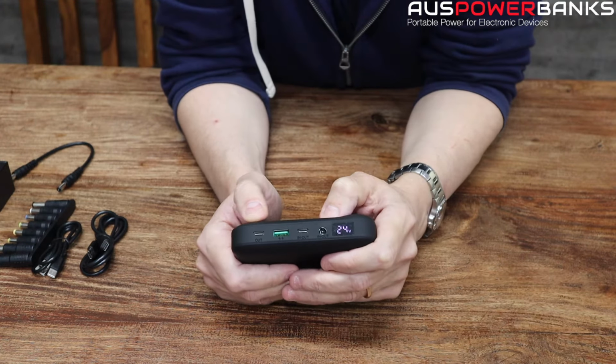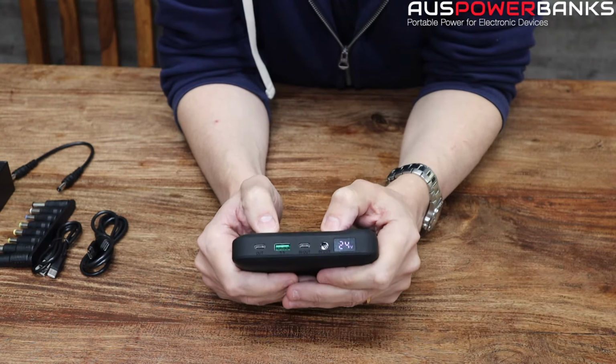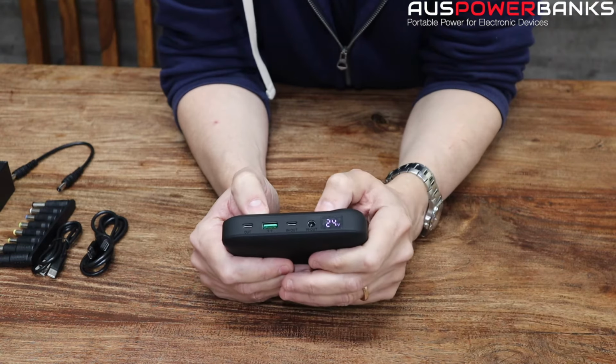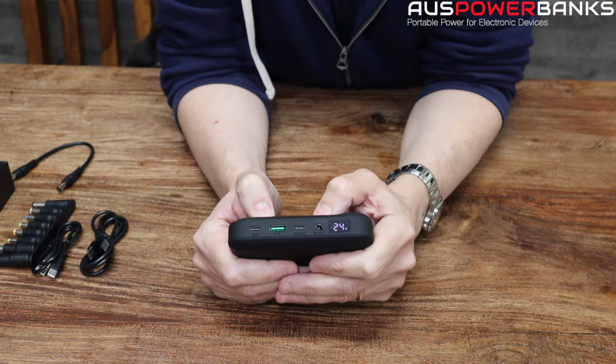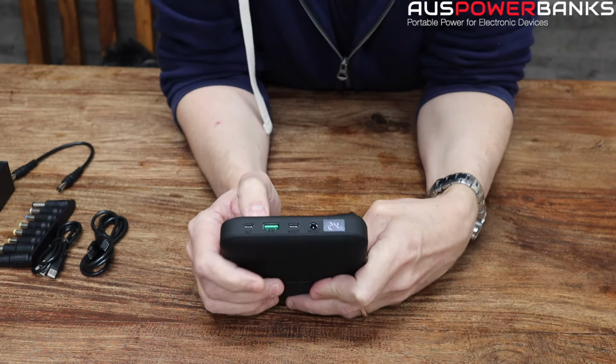You may charge a bigger laptop at a lower voltage, but you might find it a little bit slow. So just check the voltage. As I said, most will be 19, 20 volts, but just check in your specs. It tells you on your wall socket power supply anyway, your switching power supply. You can tell the exact voltage that you need.